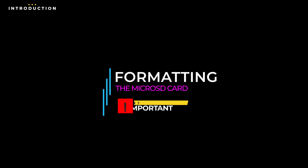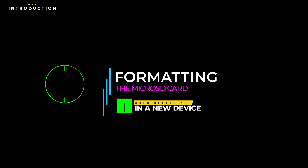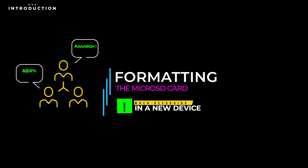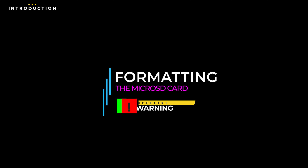What about formatting the card? Most cards come formatted out of the box, but we always recommend formatting the card when it's new. Our recommendation is to format it anytime you move it from one device to another. It only takes a couple of seconds and ensures it's in the proper format for the device you'll be using. We've heard from people who could not write to a memory card in their drone until after it had been formatted, and they didn't know it didn't work until they got home. Formatting the card will delete any data on it, so be sure to back up anything you want to keep first.